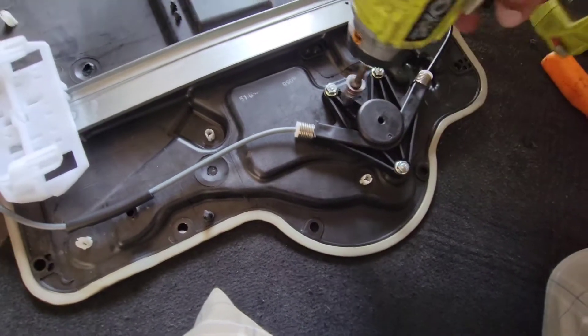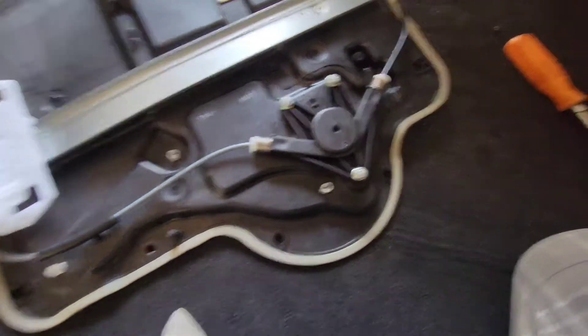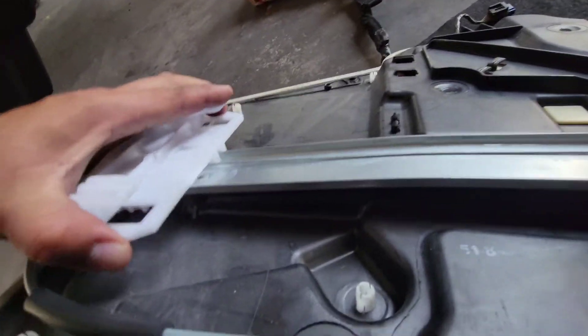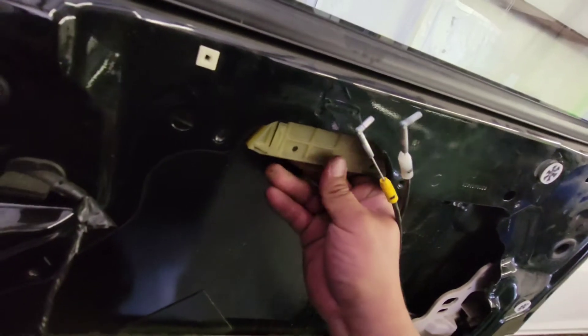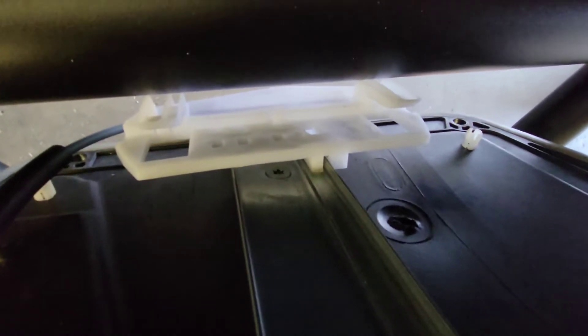And there it is — that was a bit sweet. Now that motor is attached and compressed all the way. The sucker's not going anywhere. We're ready to install this window regulator back into this Jeep. First thing we're going to do is go ahead and pick this window up — you'll probably need both hands to apply pressure on the door window because it will come back down. Then we'll go ahead and put this window regulator in.